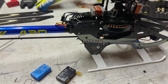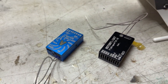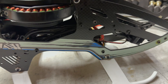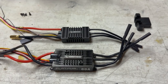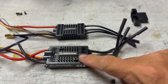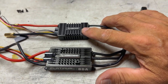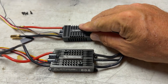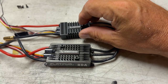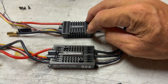The Fly Dragon has been removed and the good old Neo is ready to go back in. Next step is to pull the old ESC out — I'll do a side-by-side comparison when I get it out. Your eyes are not deceiving you — this is the 80 amp ESC I took out of my RAW 420, the old 80 amp HobbyWing ESC. Going in is the new Version 5.0. It is 3S to 8S, so it'll go up to 8S.